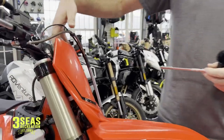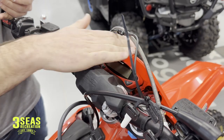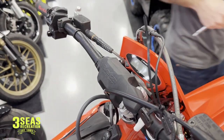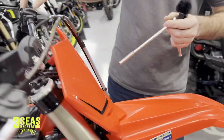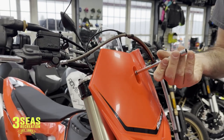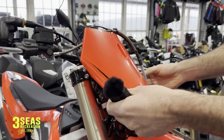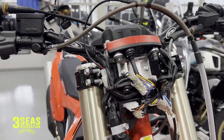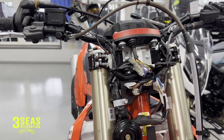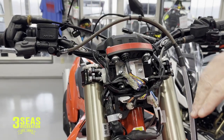This is the stock odometer installed with our kit. It's really nice — a lot of time went into it. We got it lower than the number plate because we wanted to keep it protected and didn't want rocks to hit it. But we were actually able to move it up a little bit compared to stock, which is what we really liked so you can see it better. A lot of thought went into it and we did a lot of different prototypes. Come back around to the front and we'll show you guys what it looks like with the number plate off. This is the number plate kit you're going to buy from Beta and this is the bolt that comes with it. You can see the fabrication back here — basically we moved your odometer up and moved the rest of the bracket down. It's like a four-minute install. You don't have to reroute your wires — there's one wire we do take out and we'll talk about that — but it's a very simple install.